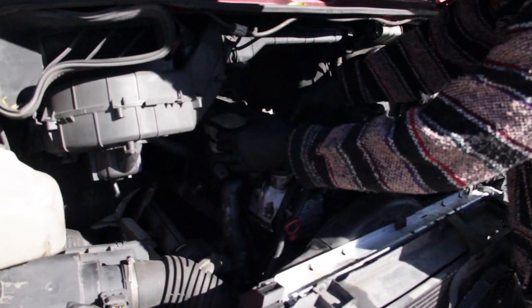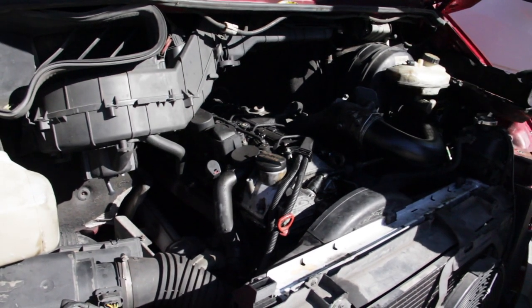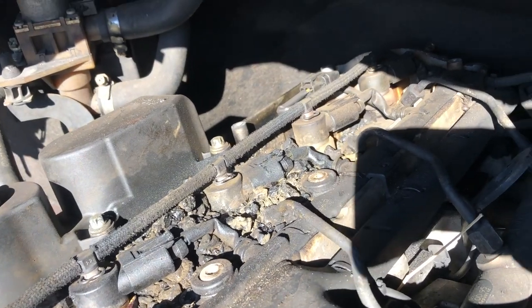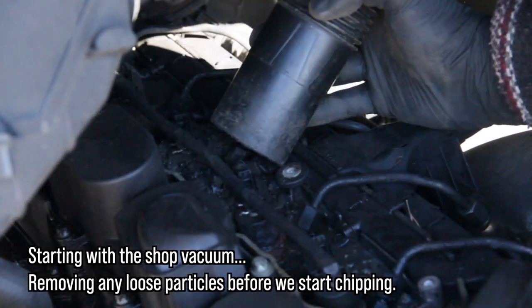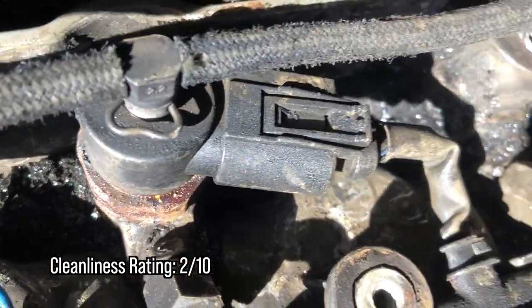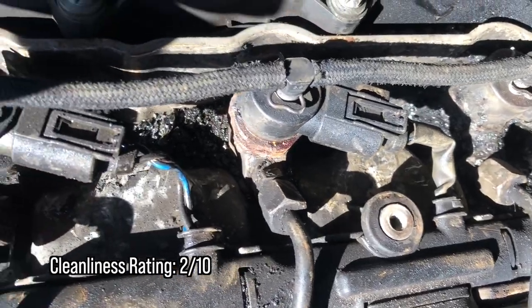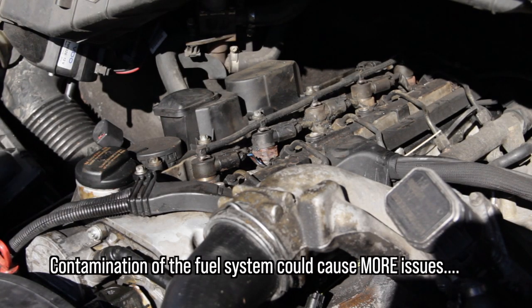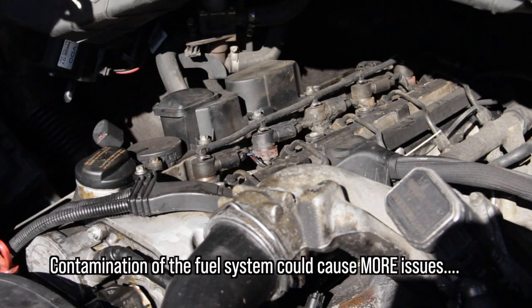We have warmed up the van now — we're at a good operating temperature. I didn't want to try to talk over it. Injector number one is not the one. What are we digging into? Two or three, or don't we know? So I'm gonna pull the wires off — probably not the top line, just the wires. I'm not gonna open up any fuel rails or get anything open where crud can get into the fuel system. I'm gonna keep everything sealed up while I'm chipping and sucking. We can pull the wires out of the way and get in there a little bit more aggressively. It looks like injector one has lost its shrouding completely on the wire.